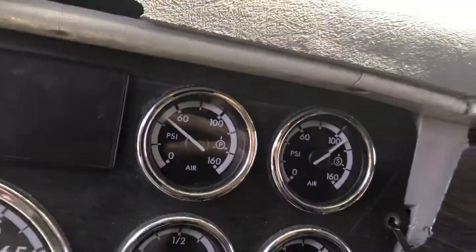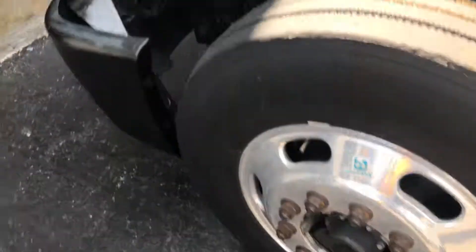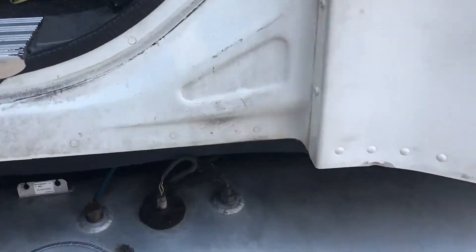So that means that our one-way check valve is working — it's not letting both tanks run through one source. We'll go ahead and call this one a pass for the check valve. The next steps would be to come down here and check your air compressor for leaks at any of the valves, run along and check your airlines — you can easily check that with some soapy water and a spray bottle. Make sure there are no leaks, because obviously we did lose a little bit too much air in that time frame. But other than that, everything seemed to be good. That concludes this video — this has been our air system check on a 2005 Freightliner Columbia.